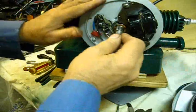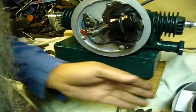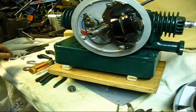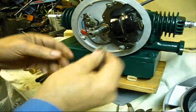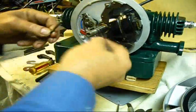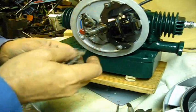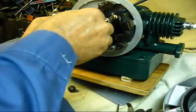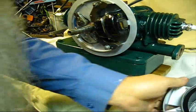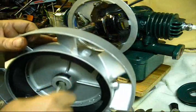We've got all of this is tight. This coil is still a little bit iffy. I want everyone to keep remembering that. Put a little oil right here on that hole, the taper part, the keyway and all. Let's put a little light oil on there, on that taper part especially. And then let's run that down in that hole on that flywheel right there, or at least an oily cloth.